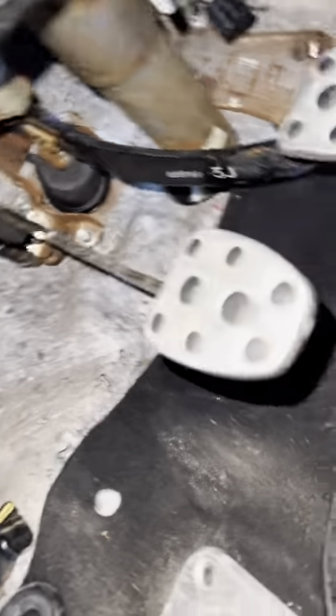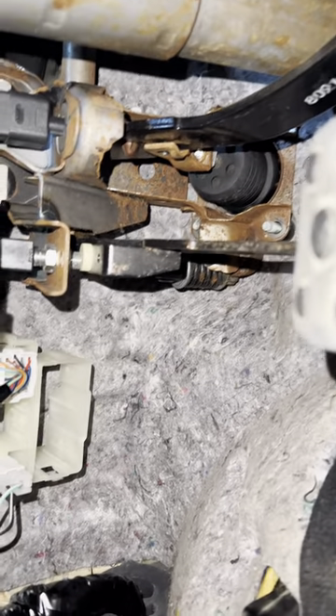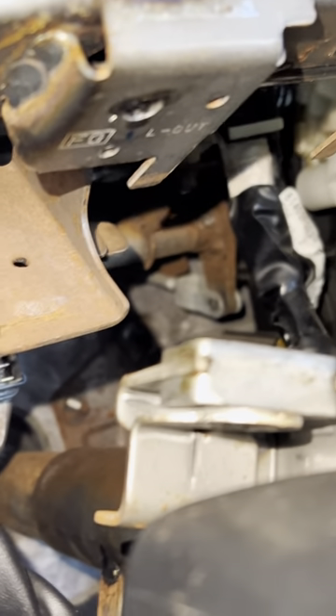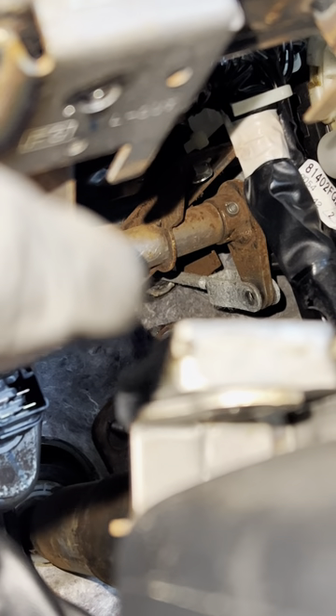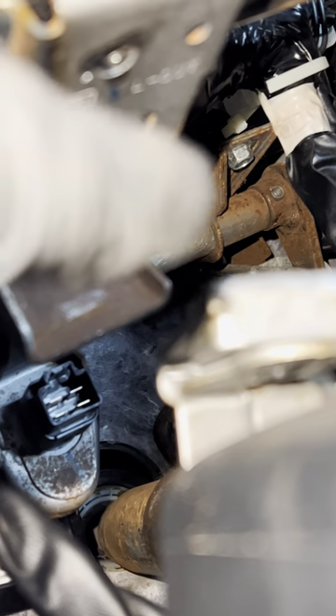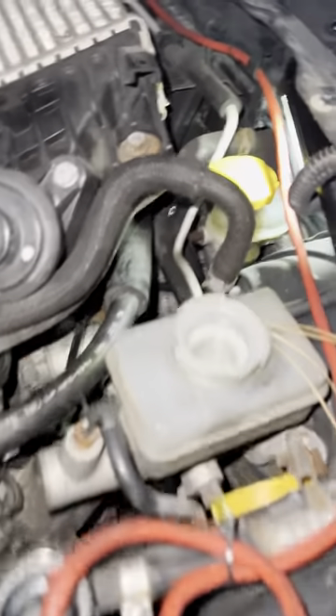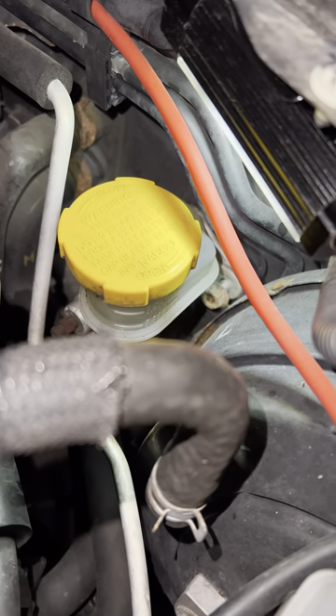I got all six bolts off — four bolts and two nuts from this side, from those four to the two that go up past the brake sensor. Now you just have to unmount. On the other side of this metal, where that rod is going to the Clutchmaster, there are two bolts on the plate behind that which hold the Clutchmaster to the firewall and to this bracket. So you're going to have to go under the hood, into the engine bay, and remove the two 12mm nuts down there.